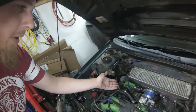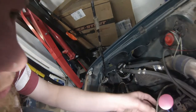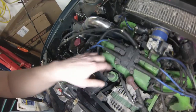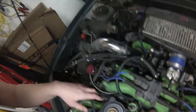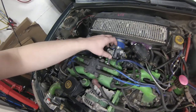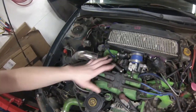Obviously you got to get some coolant and oil to the turbo. So there's a braided line coming from underneath here. It looks like it's been probably shaking around a little bit, and it shouldn't be. There's the aftermarket oil pressure gauge. Everything's all been plumbed in. The coolant going to the turbo actually comes from the lines that went to the factory throttle body, so they've been adapted to cool the turbo instead.